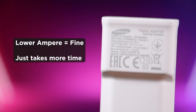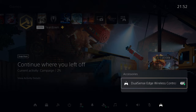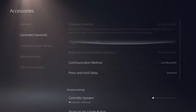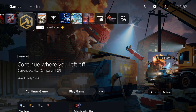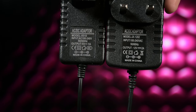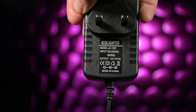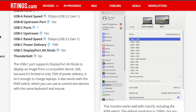What if you use a charger weaker than recommended — say 5V/1A? Don't use anything under 5 volts, as that causes problems. But if the amperage is lower — like 1A instead of 1.5A or 2A — it's okay; it will just take longer to charge without causing harm. One thing I noticed: if you play on Bluetooth while charging with a phone charger, there's a chance of more battery heat. In that case, using a 5V/1A charger actually generates less heat while playing. For USB hubs, as long as the input is rated at 5 volts you'll be fine — but hubs with 12-volt inputs are not safe. Also check the output voltage on any monitor USB charging ports before using them.